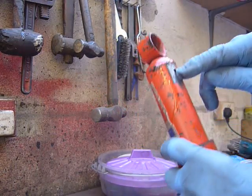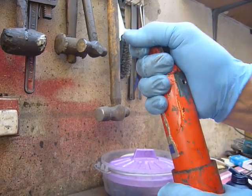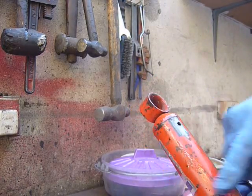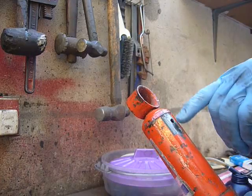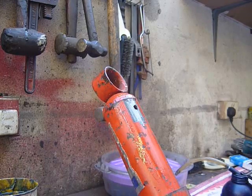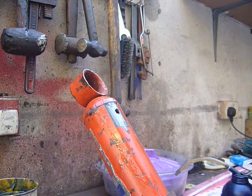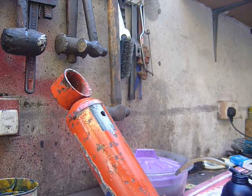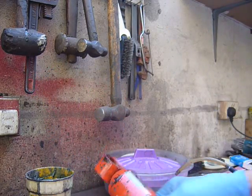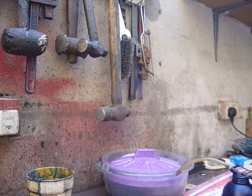While you're squirting it in, if it fills up — which it probably will do — there are internal compartments. So you need to move it up and down a couple of times and it'll go into the internal compartments. When you're totally happy, the reason you clean this metal off is you can put a blob of weld on there and seal it back up. Get your Oxy, MIG, or TIG — whatever you happen to use — and just weld that back up, a little bit of paint to make it look pretty, and put it back on the car. You've done the whole job for a few minutes' work and the amount of oil that came out — you'll probably do the whole car for less than a pint of oil, which should save you probably a few hundred quid depending on what car you're doing.